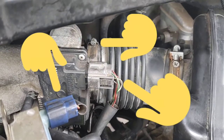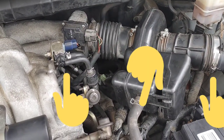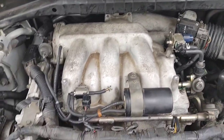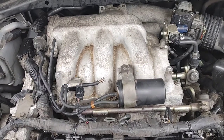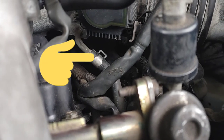What we've got to do is get those two harnesses and the intake tube off, so you'll need a flat head screwdriver. The two harnesses, that hose right there, the hose right there, and you've got one in the back on the right side as well. Don't forget the hose on the front of the intake box. Those two canisters on the front have to come off as well — a 12-mil and a 10-mil. That hose right there is held on by a hose clamp, so make sure you have a pair of slip joint pliers.